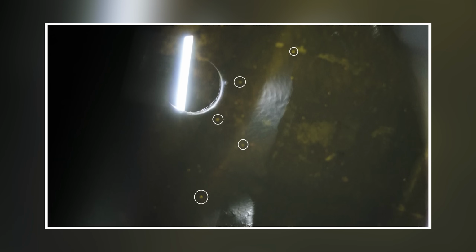So bottom line, the tank looks good. I don't see a lot of rust in there. I see some little metal flakes, but they must be aluminum. I'm not sure where that would have come from. Nothing all over the sock or the pickup inside. The sock strainer, the inlet of the sending unit, the fuel inlet, that looked good too. Just trying to think of where that could have come from. The fuel line itself, I mean, sitting for 9 years, moisture. Yeah, it's possible. The tank looks good.